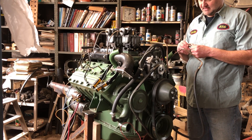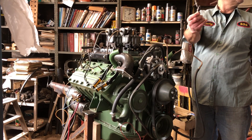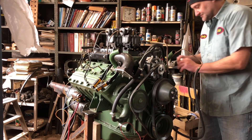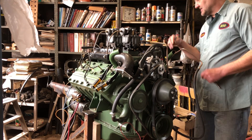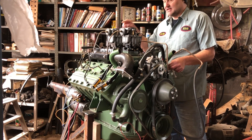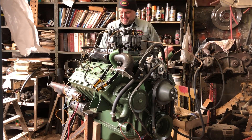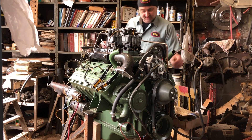Put the plug back in, get these little gaskets on it - little tiny plugs, never seen them before, 10 millimeter. Going to crank that in. Here's the plug wire - I traced it through the loom, goes to number one. I'm gonna check the firing order on all the rest because you never know who put it together the first time.